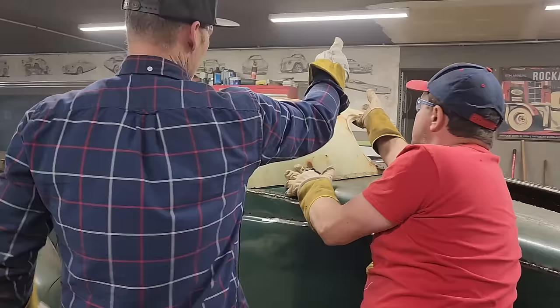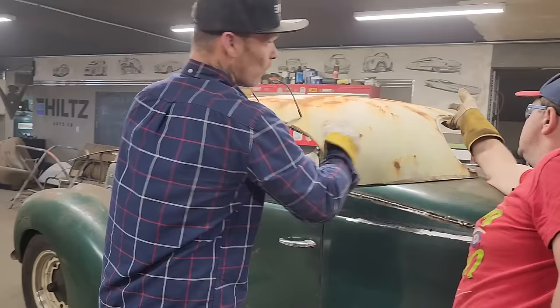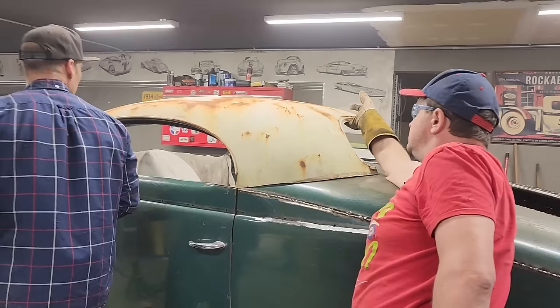That kind of turns that back window. Do you notice that? Yeah. What happened is when I cut that roof in half, it's like this. What I'm doing is I'm bringing this side over, so it's actually flipping that window out this way. You know what I mean? It's not going straight across anymore. I'm turning the roof so it's narrow in the center.